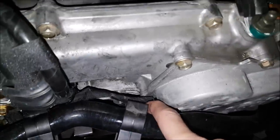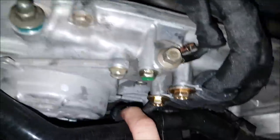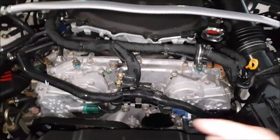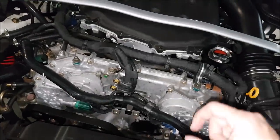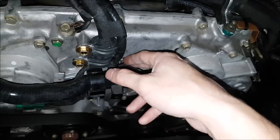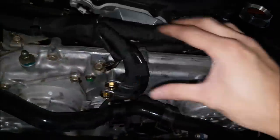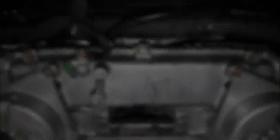Up top we have millimeters of clearance, but we're trying not to rest on any of the wiring, so I've got to relocate this guy over here. I have to organize the wire in a way that's not touching anything, which is totally possible — so we're not touching anything. I think this looks pretty good. It has that factory look. I've seen people where they remove it entirely which looks the best, where they're re-running everything. This is more for if you're trying to go for that functional cleaner look. I want it up high — I don't want to go anywhere near the belts. I've moved it closer to the engine and we're putting a cover on here, but I can still take this off because I plan to change this hose to a silicone hose. Unbolt, unbolt, move the wire forward, change the hose, put it all back — it's not that big of a hassle.